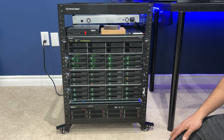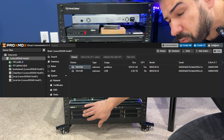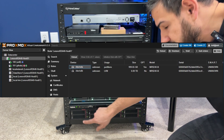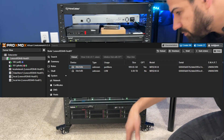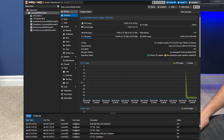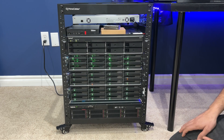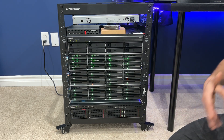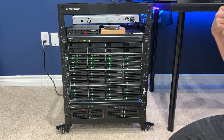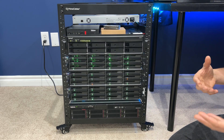For hard drive configuration and the RAID setup, the first two drives have swapped out the old 120-gig SSDs that were mirrored to one-terabyte hard drives. Now we have one terabyte mirrored for the OS running Proxmox as the hypervisor. VMware has gotten ridiculously expensive, and I believe they got rid of the free ESXi. So I said, you know what, let's try something I've never used before — we're going to give Proxmox a try and learn it. We're applying the skills learned from VMware and Hyper-V to Proxmox.